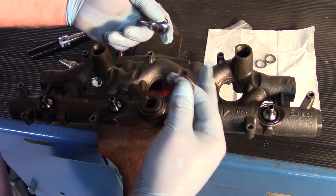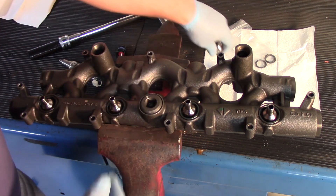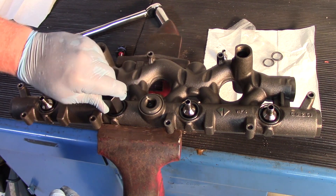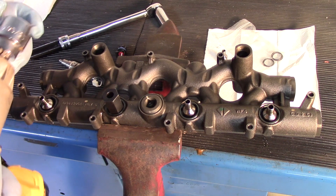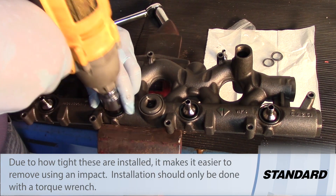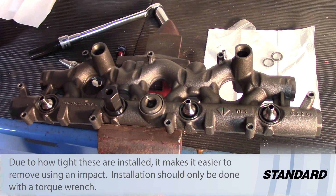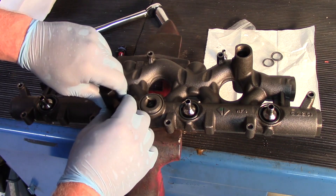In the world of good, better, best, it's a great idea to replace these ball valves as well. We've got the tool available here, so I'll insert it in there. I'm going to take an electric impact with a 15/16 socket to remove this — those things are in there pretty tight, so it's nice to hold it in the device here and use the electric impact.